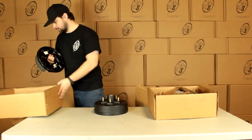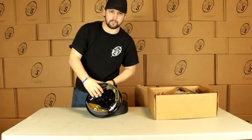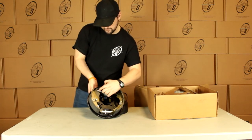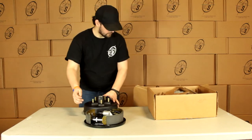Then we have our backing plate. And right here, this is our true ride hydraulic backing plate. It's got our hydraulic piston right here. And the way we tell left hand and right hand with these is we see this little part right here, that's going to be facing your truck. So we'll come over here,